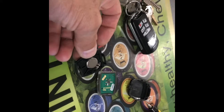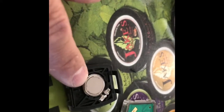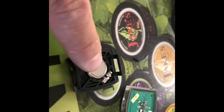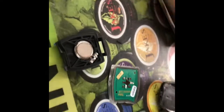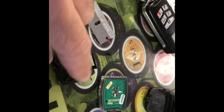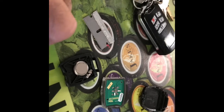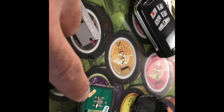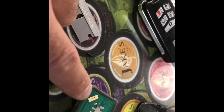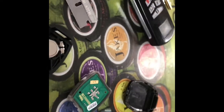If you're not getting anything at all and your buttons were working the other day, what you're gonna want to do — because this is what's happening to mine — you see them little black sections? You just need to scuff that up with a razor blade. I guarantee you're gonna get contact again. It might not be a dead battery at all. Over here you want to scuff that up too — them little markings happen after maybe four or five years of use and it's just not getting contact.